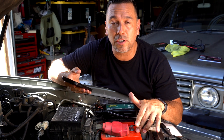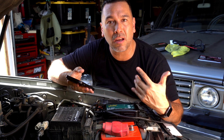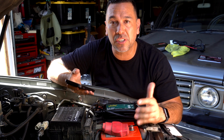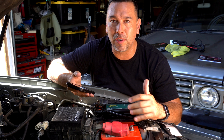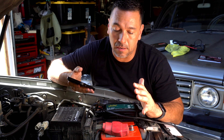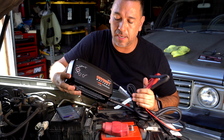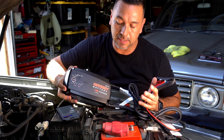This is not a bad product, it's just not enough for this big battery. This is a 100Ah battery, so it's a lot larger and it's going to take more amperage to charge correctly. Instead of 4.5 amps, anything above 10 amps is going to be a lot more helpful for this battery so you can get that full capacity and the long-lasting battery life you should have.